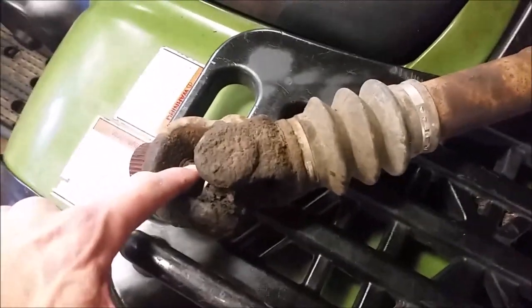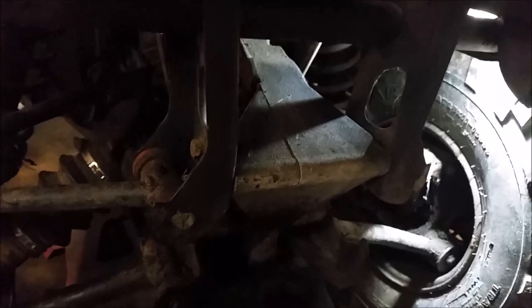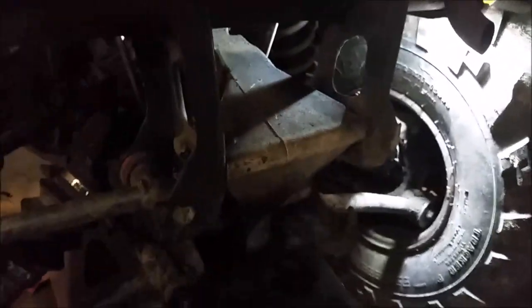On the '97s there's a bolt in here — your splines go into the transmission. I've got my wrench on it, but you also have to put a wrench on the other axle and hold it at the same time you're turning this out — otherwise it's like a nut and bolt, you've got to hold one side to get the other out. The bolt is right at the end of the shaft; I'm using a nine-sixteenths wrench, turning it little by little. I had to leave one tire on the ground so it doesn't spin, and slowly it's coming out.